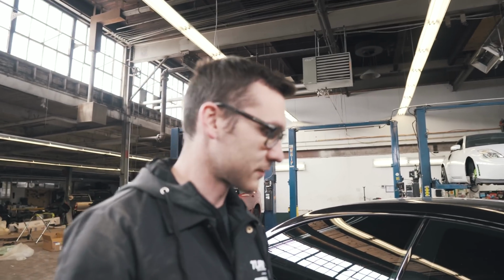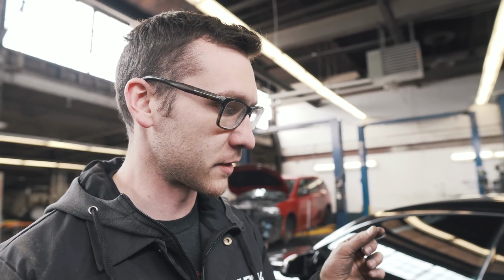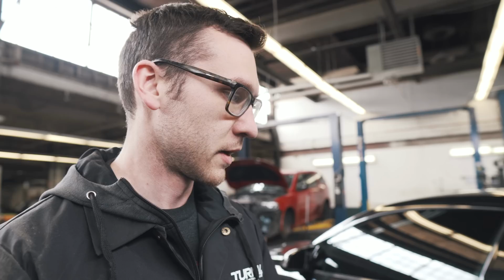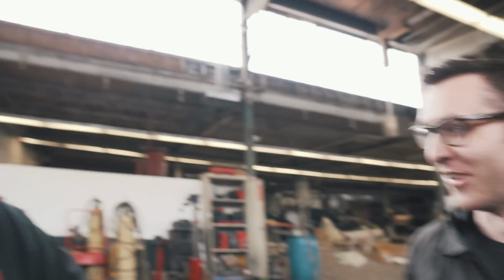All right. So basically, we just measured the faces and made sure that they cleared the brakes, which they didn't, because his brakes are big. But now we know what size spacers we've got to run to have the brakes actually clear the wheel faces. Also, he aired out with the 4-inch lip on there, so now we can compare and see what size lip he needs.